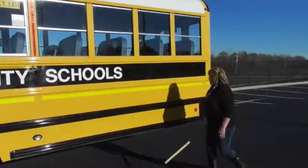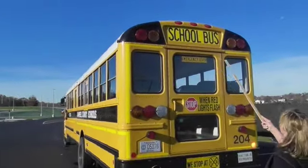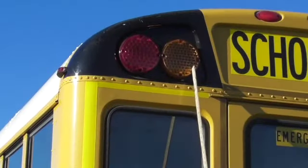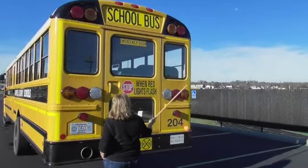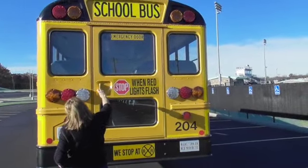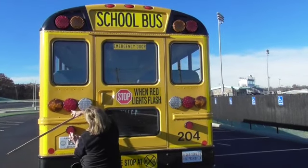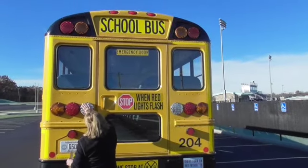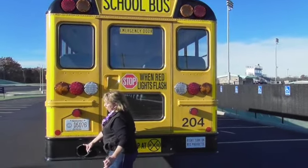This is a reverse light. On the back of the bus, at the top I've got my clearance lights, which are proper color — in this case red, not faded, cracked, or broken, properly attached. I have my amber lights and my red lights that are part of my eight-way system, proper color, not faded, cracked, or broken. The school bus reflective tape and all reflective tape appears to be properly mounted, not peeling, and all legible. My glass is relatively clean and seals are not dry rotted. Here we have my turn signals and hazard lights. These are large and small brake lights, also my tail lights — two of them must both be accounted for. This is your backup light. There's a light for my license plate and my license plate is present. And my tailpipe must be one inch past my bumper.